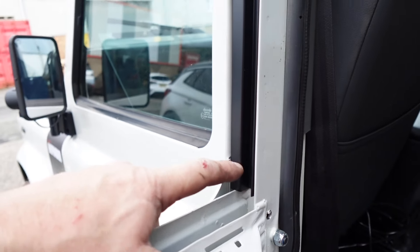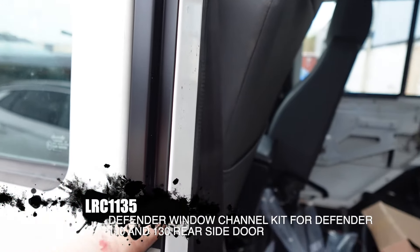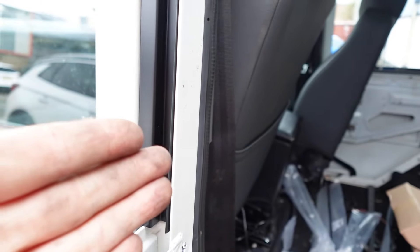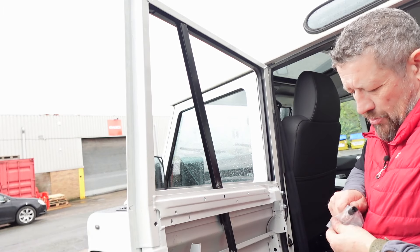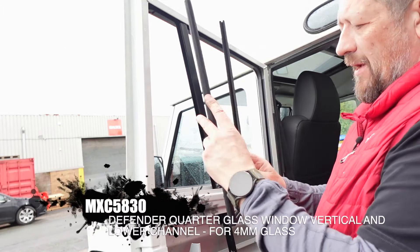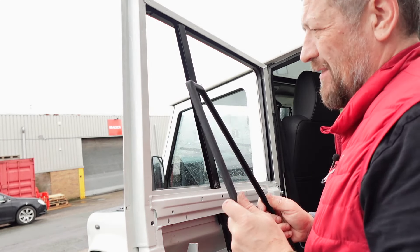I am fitting all new plastic extrusions, which comes as a kit from LR Parts including the corner pieces. What's interesting is these channels actually have one slightly wider channel than the other — the wider channel goes on the inside of the door where your felt runner is going to slide, and the narrow one just fills the outside gap. Then you can slot your corners in. This next stage is probably the trickiest bit of the build — we've got to install our channel. The channel actually goes in upside down, and our glass has to go in from the bottom as well, but I find it easier from the top.